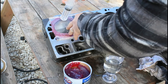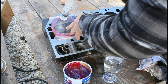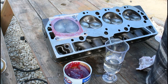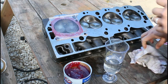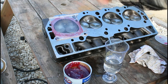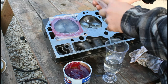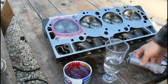Now this one should get pretty close. Okay, so we are at 5 cc's left and this chamber is full — you've seen a drop come out of there. So you take 120 and subtract 5, that's 115 cc's. I've done this three times and that's what I come up with every time: 115 cc's. So you have two 60-milliliter syringes, that's 120 total, and there was 5 left over — subtract that extra 5 from 120 and get 115.